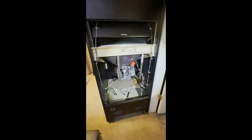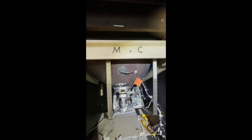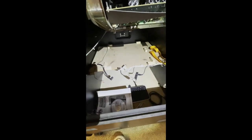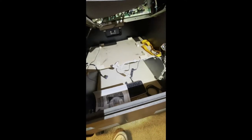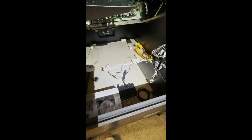Here's what the guts of the machine look like without the PC installed. There's the old CRT CGA monitor, the PCB boards and controller for the game system, and then down low you've got the power cable, ground cable, PS2 mouse controller, USB, the VGA connector, and the speaker cable that all plug right into the back of the Pentium PC and make the whole system work.